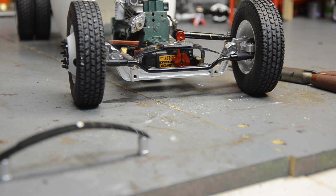Trying to keep it as low profile as possible - we've already got the mount in place. It would be possible to flip the leaf spring to the top side of the mount and we might explore that option as we get further into this. But I think I'm going to end up making my own leaf pack out of just spare leaves so I can get everything the right length. I really don't need but one leaf on there for actual function, but it's going to look better having a couple - it's just going to look more scale. So I'm going to start taking that stuff off and we'll see where this leaves us.